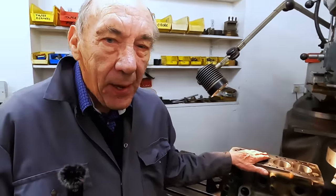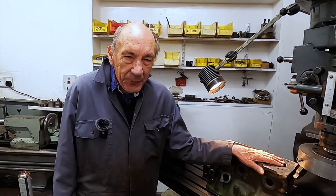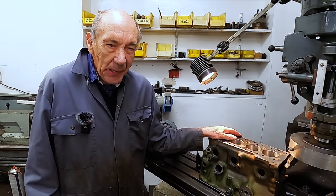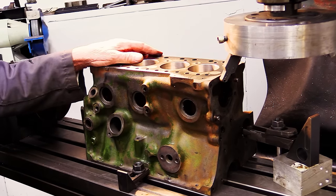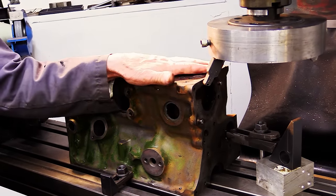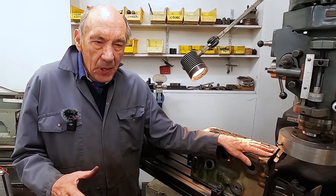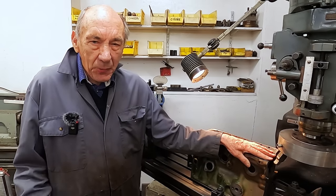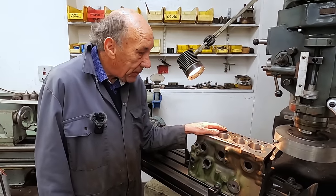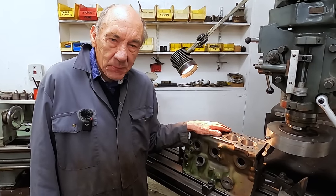Right. And when it was together, I measured how far down the bores the pistons were. So I reckon we've got scope to take a whisker off here. Now, I don't think we're cheating, because the bloke in 1960 could have easily gone down to his machine shop and said, can you take 10 thou off of there? But the thing is, I'm going out to get some compression, because modern fuels are good. Even the ones they don't reckon are good, as far as I'm concerned, seem good. So obviously you've got to be really careful, because you could take too much off.